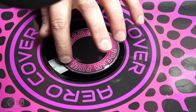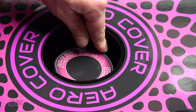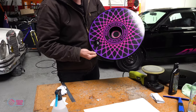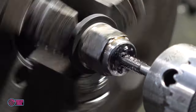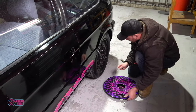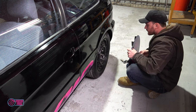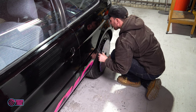The final piece of the puzzle were these little dome stickers — again a bit of a nod to the original BBS wheels. After much planning at the start of the project, I decided the original Toyota acorn nuts with the ends drilled and tapped would be the way to attach them. Aside from being an utter mongrel to put on and take off, they worked really really well.